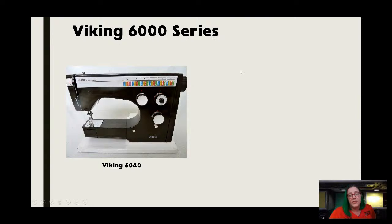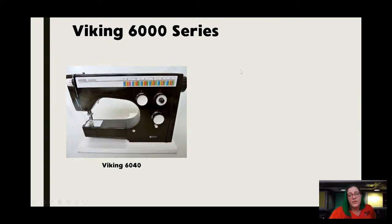I do want to give you a little bit of info about the problem with this machine — there are tons of them out there, and in this case I'm going to tell you yes, the repair is worth it. First of all, if you turn around to the back of the machine where you put your cams in, this is very common right now — that is the cam gear, which changes the stitch selection for you. You can see there's a big crack there.